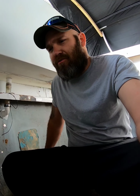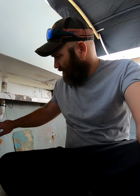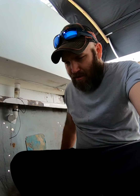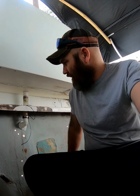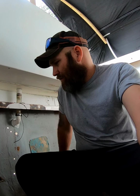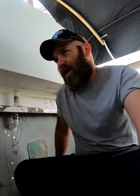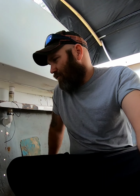And let me explain. I know I said I was going to do everything in epoxy, but with holes this big, I'm going to have to bore them out a little bigger to get to fresh glass. Then I'm going to have to fill them, and then cover them with a fiberglass patch. 1708 is not as smooth of a finish. To use chop strand matting, you have to use polyester resin because of the binder in the chop strand matting. The epoxy won't dissolve the binder that's holding the chop strand matting together. The name of the binder is eluding me at the moment. It's styrene. Yeah, styrene. But polyester resin and vinyl ester resin will dissolve the styrene.